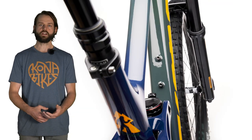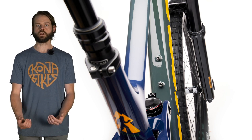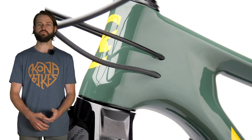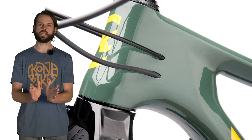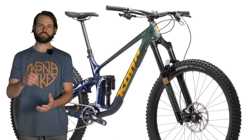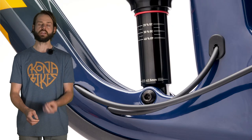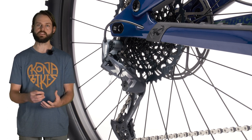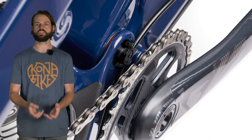We've got improved water bottle fit on all frame sizes. The bike is available in sizes small through extra large, and we'll get into the geometry dimensions shortly. The cable routing on the frame very closely mimics what we've done with our Process 134 models — there's a Y connector for the rear brake that allows it to be routed on either side of the head tube. It's a tube-in-tube construction, and we've also got tube-in-tube for the dropper post and for the rear derailleur. The rear derailleur cable is captured on the main pivot, which really minimizes the amount of rotation the cable undergoes while the suspension is moving.